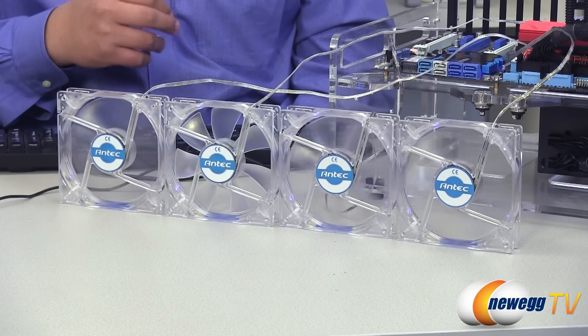This calibration is important because preset modes — silent, standard, turbo, or full fan speed — need to use accurate calibrated data to be meaningful. With calibration, 'silent' mode can actually be silent, potentially turning off chassis fans entirely since the software now knows the true minimum operating value of each fan. After calibration, all fan data including maximum, minimum, and midpoint targets is available for review and manual adjustment.